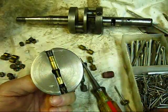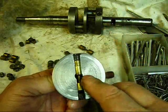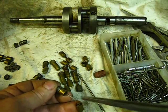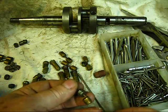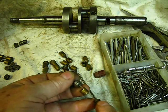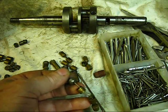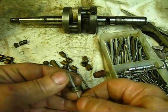It's a model 72 governor assembly and it's so simple in its action. The secret is that all of this should be completely clean and free. Go to the trouble of getting some unplated cotters. If you have a spring like this that's askew, fix it — cut that off, turn it over, make another loop and hook it back. Don't use a damaged spring; if that was in your engine it was probably the reason it wasn't running right.